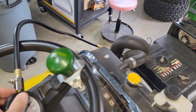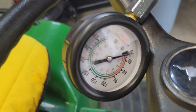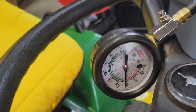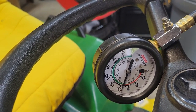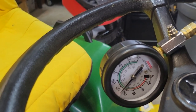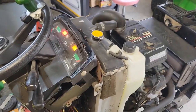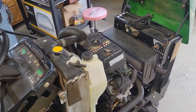We got cylinder two hooked up, and this one's going to be harder to see. Got a little glare. Here we go, cylinder two. Keep on cranking — that's coming up real slow. 140. That side didn't come up as quick as cylinder one.